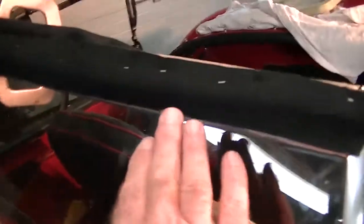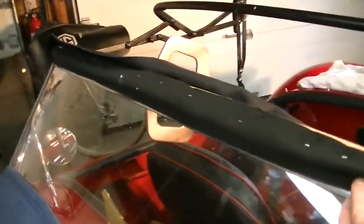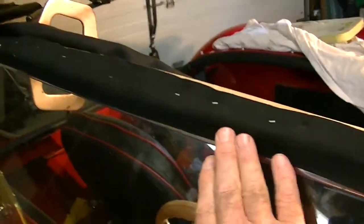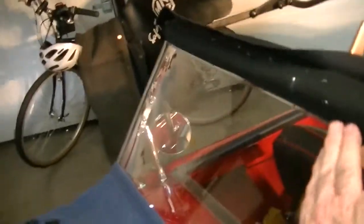Going across here is very straightforward, except that the board in the front kind of curves down, so when you figure out where to staple the front edge, you have to kind of push in so that there's enough material wrapping around the front, and then you staple it. You kind of have to pinch it. If you just hang it down and staple it up here without pushing in to allow for a little room, it tends to pull it up too far because there's no material left to go around the curve. I made that mistake and I've just fixed it.